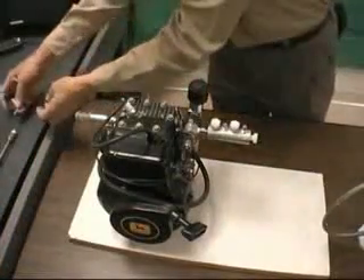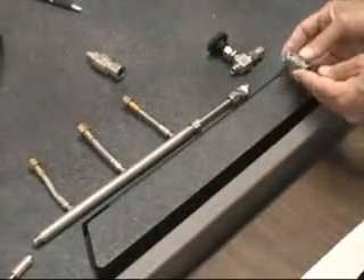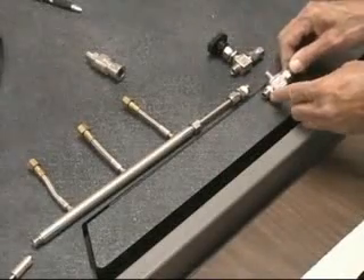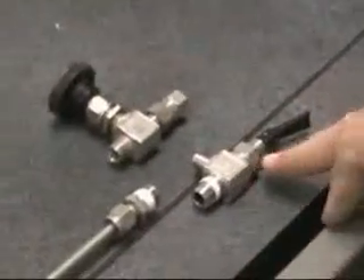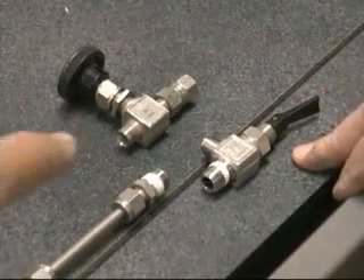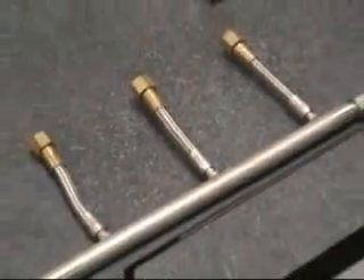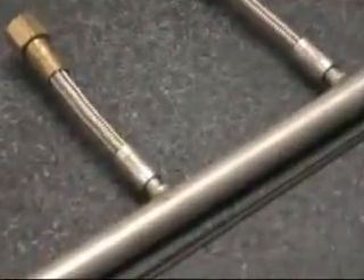You can make this so that it's manifolded for the entire system — manifolded for a hand valve, or a combination with a foot-feed operated flow valve — giving the ability to do everything your automobile does today off of a single control for high-speed operation and a single control for idle. And it's exactly this valve and this manifold that we were driving around on in the Geo outside. That simple.